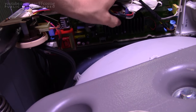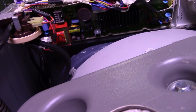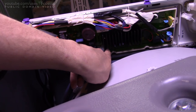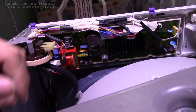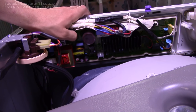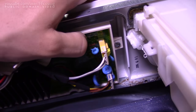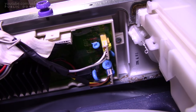I think the first course of action is going to be to just heat this board up and see if it starts, because if that brings it back to life then it's likely to be a capacitor issue - probably one of these small tiny ones, or perhaps even a solder joint. It's going to be annoying working on either way because we've got everything potted in this really thick goopy potting compound, which probably does a very good job at keeping water out but yeah, that's about all the good it does.